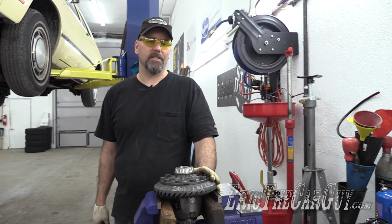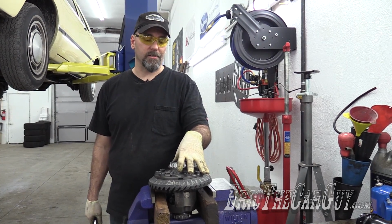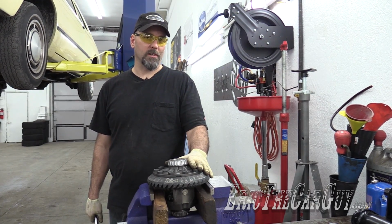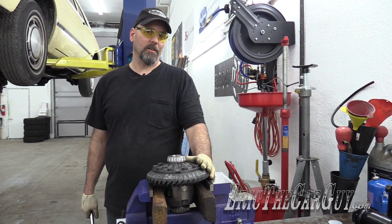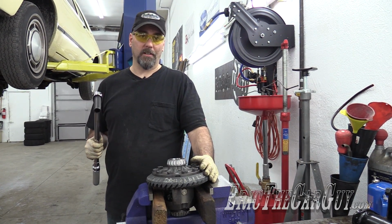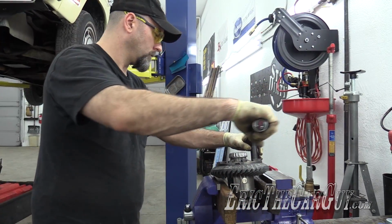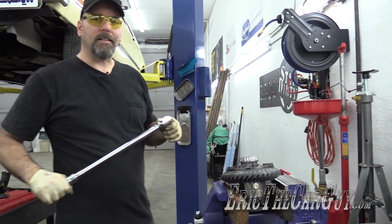I don't know if I mentioned this yet, but these are Ford gears that I'm using and Ford parts. It's a Ford differential also. And I'm taking my information directly from the Ford PDF, which will be linked in the description. I just rechecked the torque spec and it says 97 to 102 foot-pounds on these. I'm gonna go for 100, right in the middle. Right now, since I've already gone to 50, I'm gonna go to 80, and then we'll take it all the way up to that final 100. Let's take it to that 100.